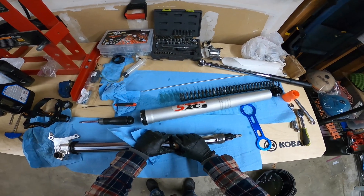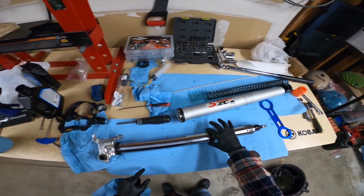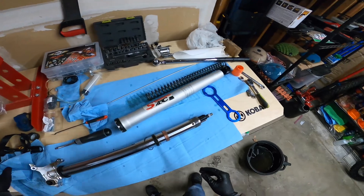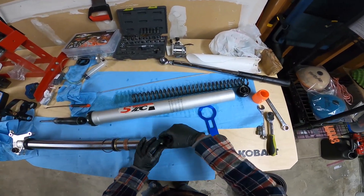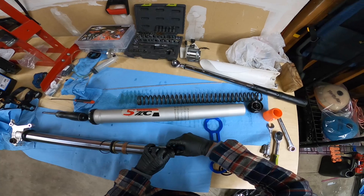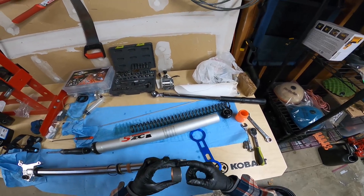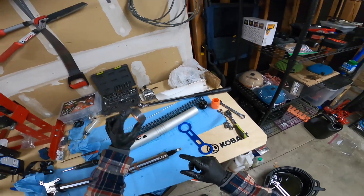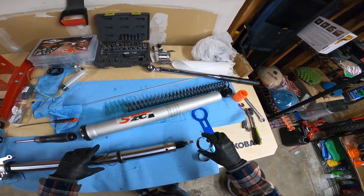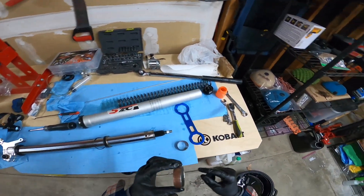So that's what you have on here: two bushings, this washer, seal, clip, and dust seal. It's a nice easy one to get off — just pry it. As far as I'm aware, these run on the outside, so that's where you're looking for the Teflon coating to be good, and that looks fine to me. And we got the lower one — this one runs on the inside. If we look at the inside, it doesn't look too bad. So: up bushing goes down, washer, seal, clip, and dust seal.